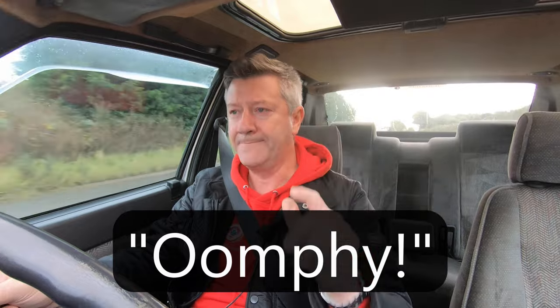I'm in fourth doing 40 miles an hour. Put my foot down - it's very smooth, it picks up nicely, there's no hesitation, there's no jerkiness. It's just not that oomphy. It's a five-speed gearbox. On a long straight in fifth gear doing 60 miles an hour, the tachometer is reading 2,600 RPM, which is fairly high. Although I'd like a noisier exhaust to hear the Busso revving away, on longer journeys that might get a bit tiresome because the gearbox is fairly low geared.